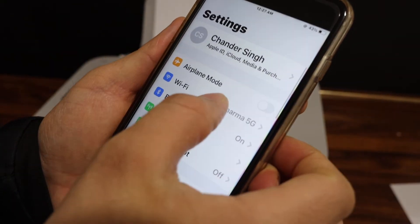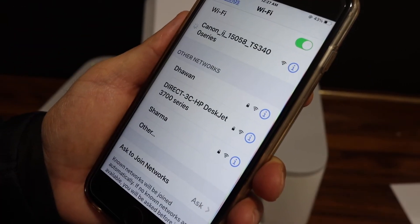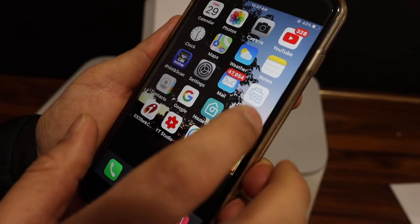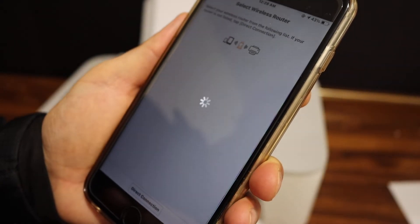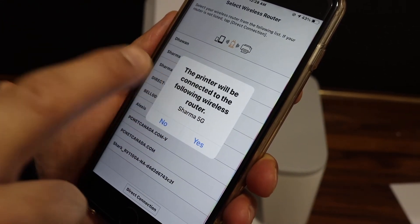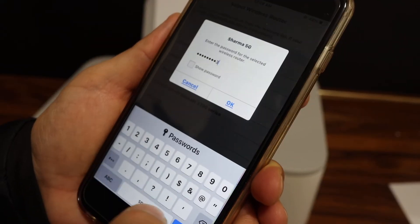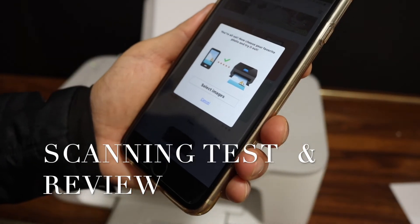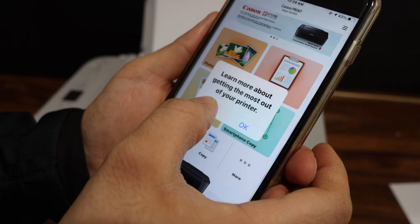Confirm on the screen and click OK once you see the confirmation message. Now open the Wi-Fi settings of your device. In the Wi-Fi settings, look for your printer's name — that is TS-3400 — and click it to connect with the printer. Go back and open the app again, then click OK on the panel. It will show the name of the Wi-Fi network it's going to connect to. Click yes, enter the password for your home Wi-Fi network, and click OK. You can see it is now connected to the Wi-Fi network.